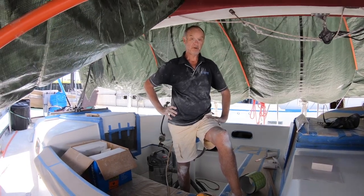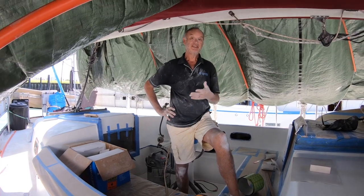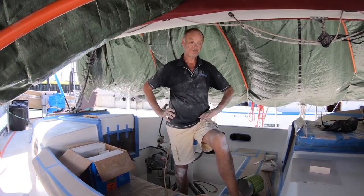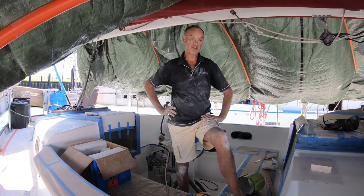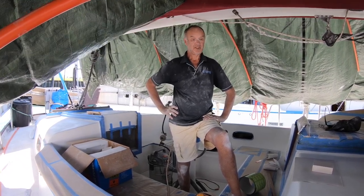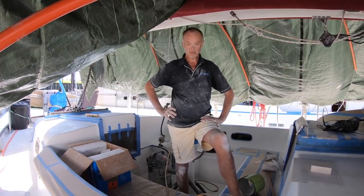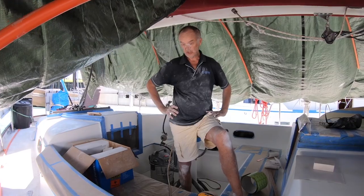The top coat paint will probably fill the dimples, but the trouble is, because the dimples aren't sanded, you rely on a mechanical bond between the top coat and the primer. So he's been here since 8 o'clock this morning. We actually got a lot done. I'll just show you where we're at.